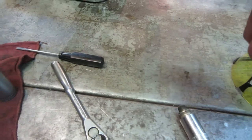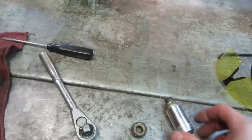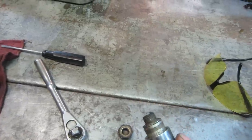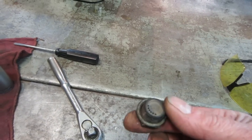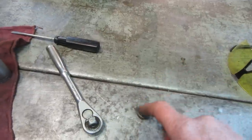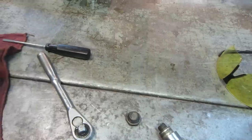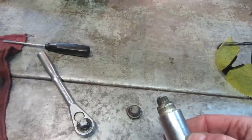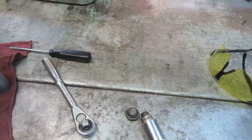So what this thing actually has in it too is an anti-fouler. So that's in the spark plug hole, and then the spark plug is in there. I'm kind of wondering if possibly it's just kind of starving for spark a little bit, having to seek out going through that. Unfortunately, I do not have, this is an old style spark plug that would fit in there. And I wanted to try something different. I wanted to see if the other red APU unit had that setup, but it does not. So kind of still has me left guessing on what's causing it.